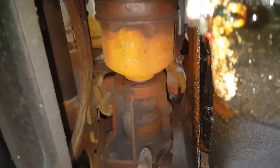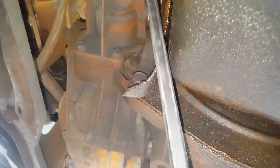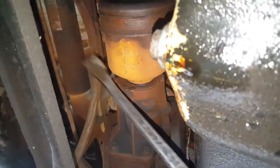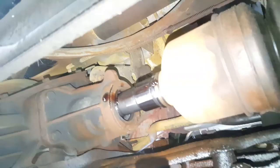Laid up underneath the vehicle, you can see this bolt. All we have to do is take a pry bar and pop this out — push it in that direction. Using the same pry bar I had, you just want to watch out because it's going to leak some fluid. So you just rock this thing back and forth any which way you can get it, just until you pop it out of there. I'm kind of on this collar, working it on both sides. I'm just going to continue rocking it until I get it completely loose. And there we have it — I got that slid out.